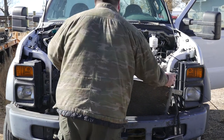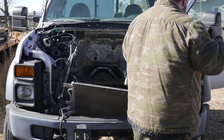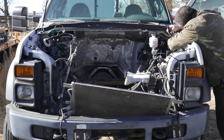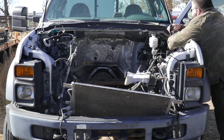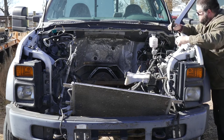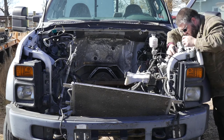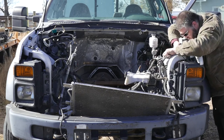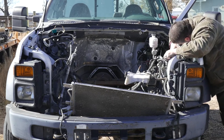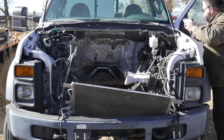Putting in this wiring harness is mostly just an exercise in patience. The bolts that hold the battery junction box — the engine fuse box — into the cab: there are three bolts and they have 13 millimeter heads. I'm not sure exactly where my other bolt went. I thought it went down here the other day. I might have to pull this fender liner out to get that bolt out.